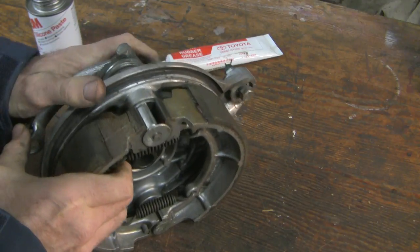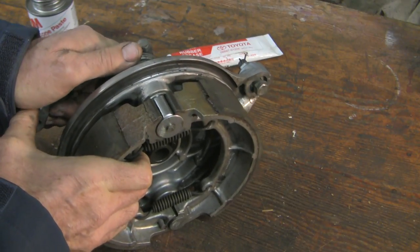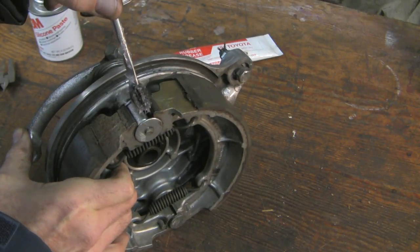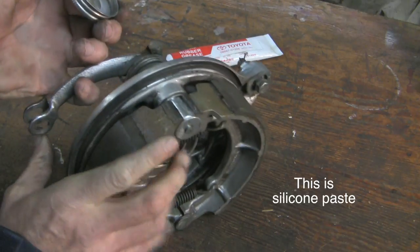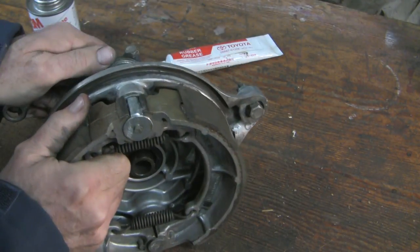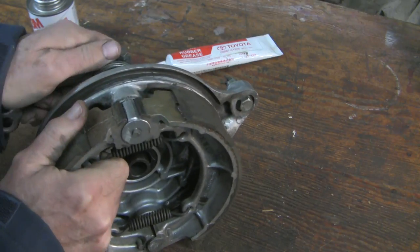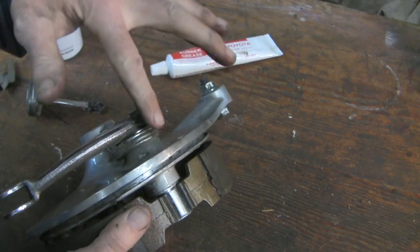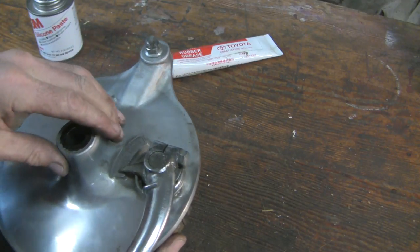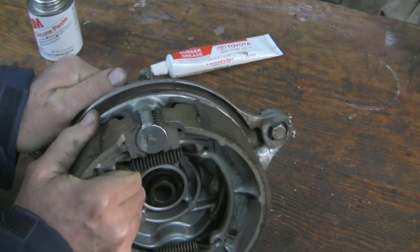I'm going to lube this contact surface here. The question is what lube do you use? In general you use something like brake caliper grease, which needs to be stable at high temperatures because these can get really hot. You also want to make sure you don't get it everywhere - just a little dab on both sides, work it through, and wipe off the excess because you don't want to get it on the shoes. Now you can also remove and clean off the whole lever assembly, but you'd need to mark exactly where you're at to reproduce those positions. This bike has lived indoors the vast majority of its life and I'm not seeing any evidence of dysfunction, so I'm just going to put it back together.